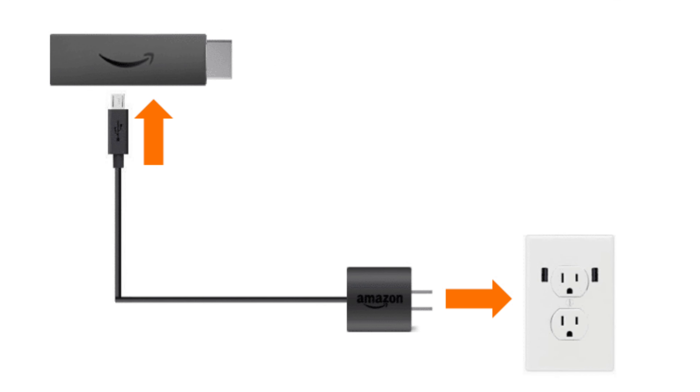If you do use the TV's USB port, first test it with the cable that comes with the Fire Stick to confirm it stays on consistently. If it works, I'll leave links in the description to shorter USB cables so you don't have a long wire hanging off the back of your TV. What I do personally is roll up the included cable, put a zip tie on it, and only use the length I need. But please test your setup before purchasing a shorter cable to make sure the USB won't cause your Fire Stick to turn off or fail to power on.